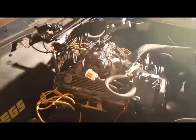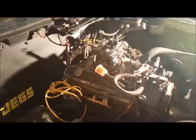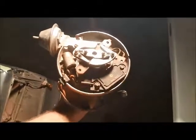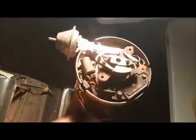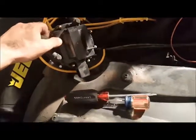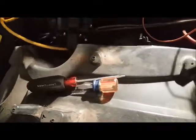So I got to top dead center. I pulled the distributor out. Here, I'll show you — this is what it currently looks like. I'm going to show it under the light. I'm going to replace the module and get a tune-up kit, so it'll replace the module, all the weights, the vacuum port, and then also I'm going to get a whole new coil for the top here. There's a coil on the top, so I'm going to get a whole new coil — I think it's the 50,000 volt coil.